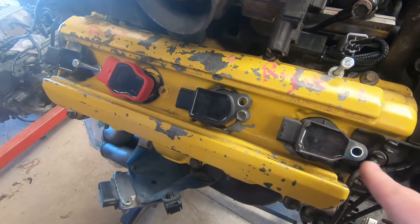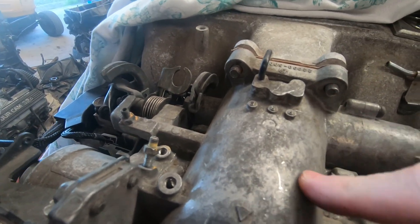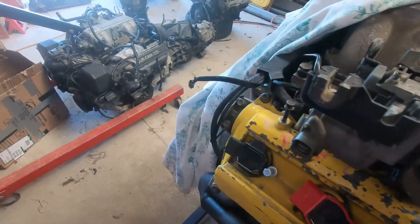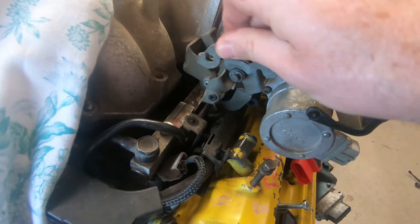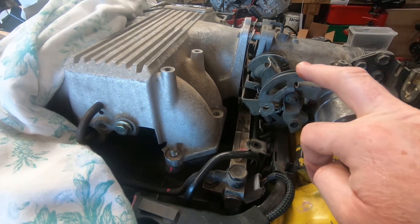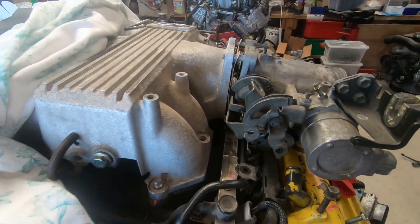That's slightly different on the old yellow one here. There's the same sort of fitting again — this is a JDM throttle body. It has the little matrix here for the vacuum system, but again it goes around to that VSV for the purge. Another interesting thing to note on the throttle bodies: you US guys, or the left-hand drive guys, the throttle cable pulls from this side. I believe you'll find the throttle cable comes in and the throttle body pulls differently — I'd love to see some photos of the US ones.